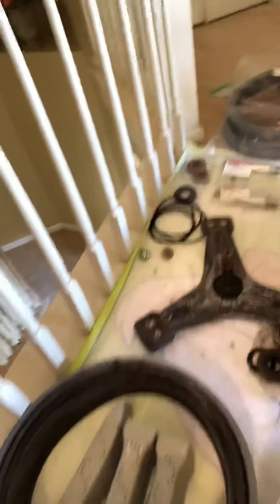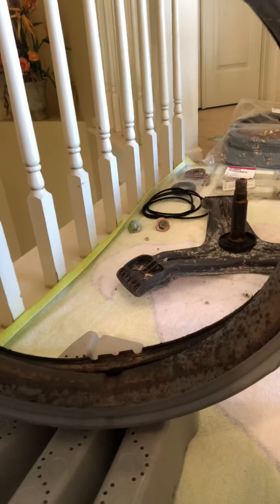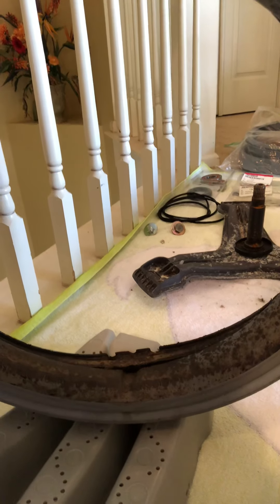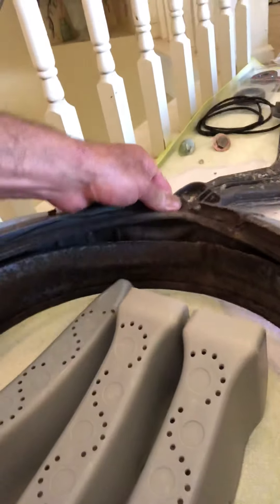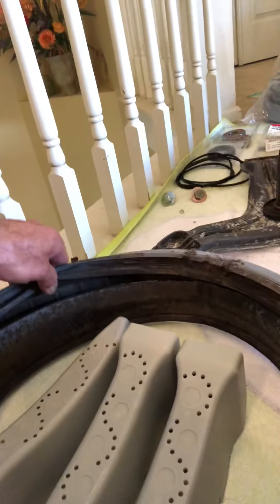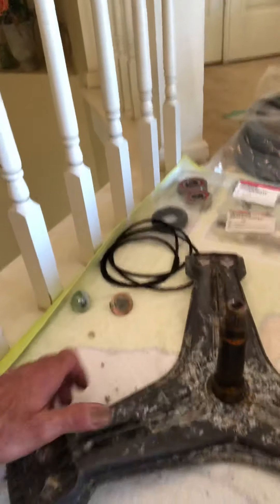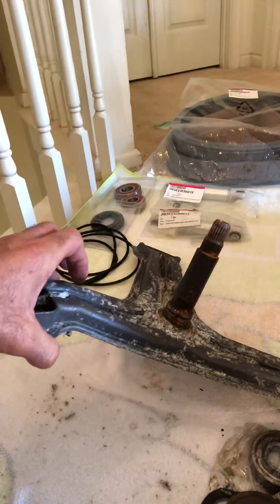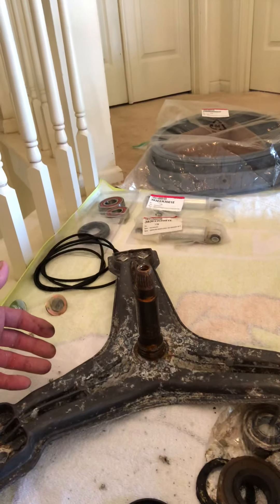When I got all the parts apart, I could see the rubber boot — the one that goes around the outside sealing against the door. It's always got mold and gunk on it; your washer's always smelling and stinking. Once I got into this I couldn't put that back on — it was all crunchy and nasty. So I had to order a new one. And then looking at the spider, it didn't make sense to put new bearings on that shaft. You could sand it down, it still wouldn't be good enough where the rubber seal goes.